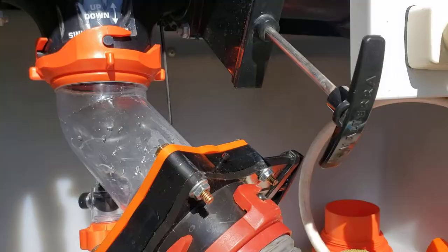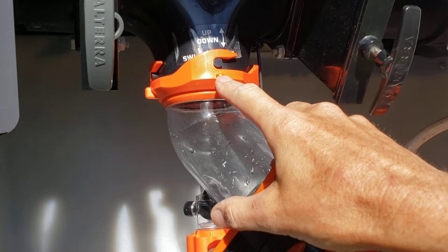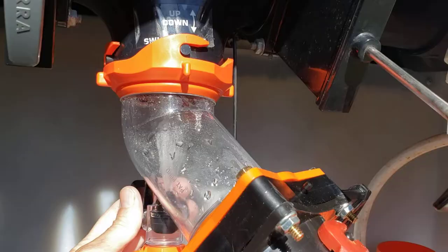Open the black tank valve now. If you make a mistake and keep everything closed and turn this thing on, something's going to blow — you'll break these plastic fittings right off because you'll have so much water pressure. Make sure something is open. The same thing could happen on your gray tank, but it's not as likely. So let's open this valve up.